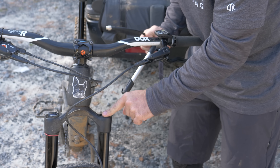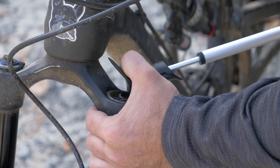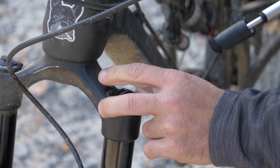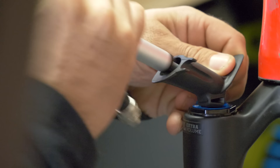Your shock pump can actually be used as a slide hammer to knock the air cap loose. Just brace the handle of the pump on the cap, and then use the body of the pump to initiate a precise impact. This won't scratch your air cap, and it makes use of a tool you already have handy. It also works with most suspension forks.